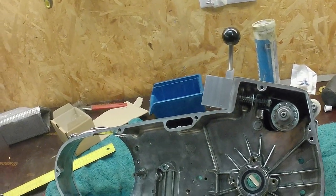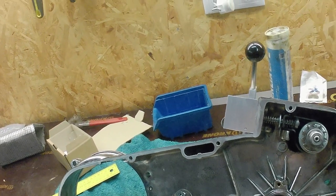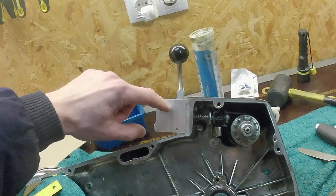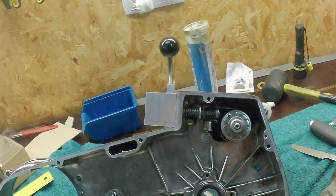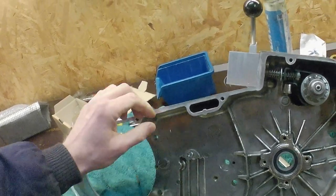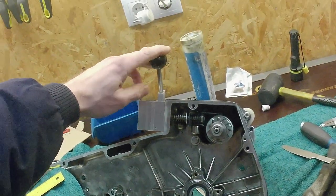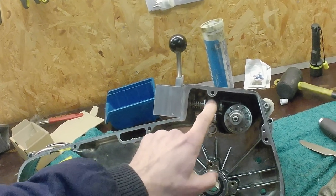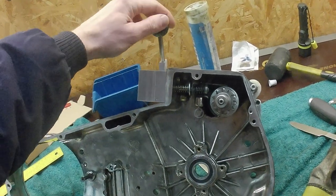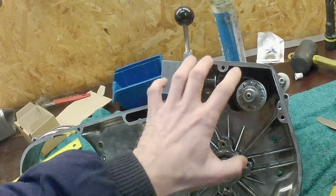What I have here is a new hand shifter. I had so many solenoids before and they were always a problem. A few times I almost burned my motorcycle because the solenoid stuck - the power was there, the power cable went red hot and started burning. So I said why on earth and I bought this. It's expensive but it's nice. It was a bit problematic to put on because of the different angles - it was binding and didn't want to work smoothly, so I had to grind it a little and bend it to find the sweet spot. Now it works perfectly.